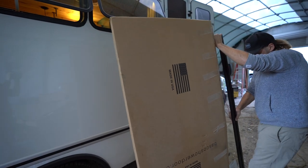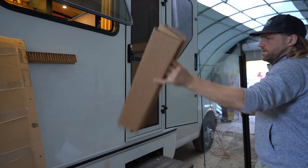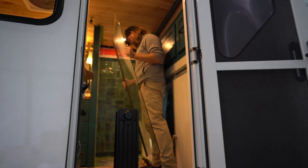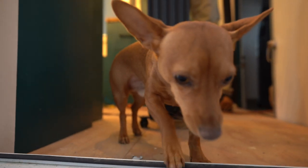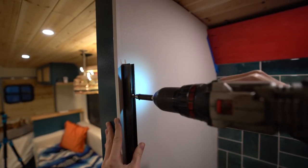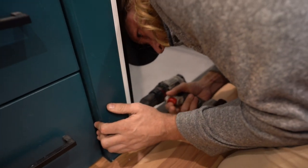Now it was time to install the shower door. You might recognize it — it's the same exact one we used last year in the previous bus build. We really liked it so we went with it again. When installing this, you screw the framing on each side of the wall and then screw the door into the framing. You want to make sure you have the right size door — sizing your shower and then getting your door and realizing it's either a little too tight or a little too big is a problem. I always think the way to go, though I made this mistake here, is to order your shower door first, get that, then build the stall to it. Ours was just a bit short.